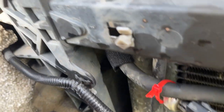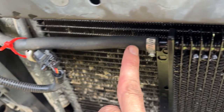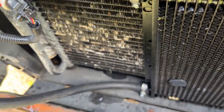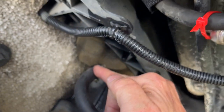What I did — this is the factory line right here, attached to this. All I did was undo this, attach it to my transmission cooler, and then run a little bit of the hose that came with your Hayden kit right there, and attach it right there.